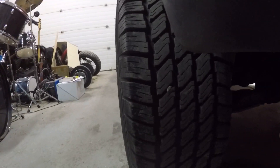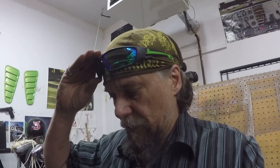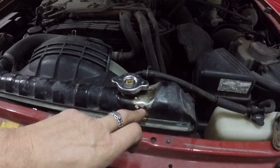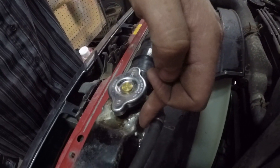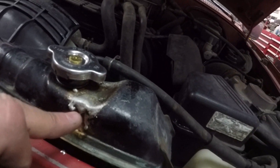We did have a leak in the radiator. It turned out to be a very minor leak. First I thought it was a cap, so I put a new cap on it. And then as I filled it up and warmed it up to temperature, I could see it wasn't just a cap. The cap was probably okay, but we had a leak here and here — very tiny hairline cracks on both sides. And as you can see, I soldered that up. I think we're good to go there. Just got to test drive a little more and see how that works out.